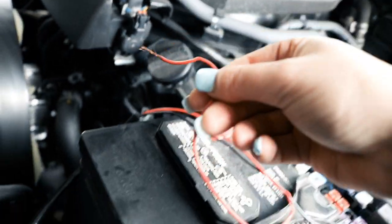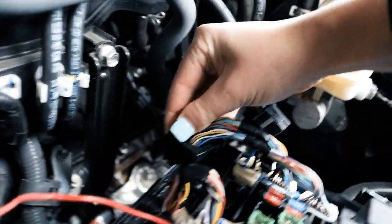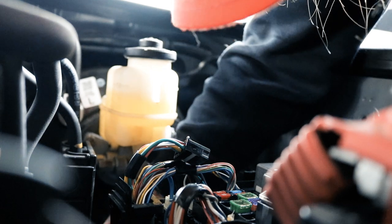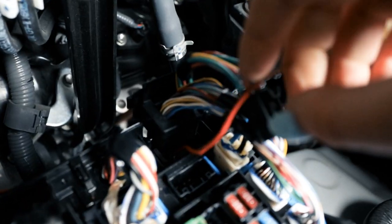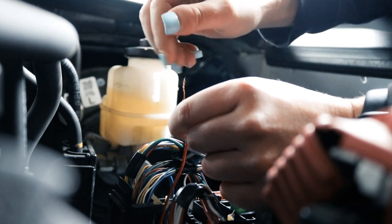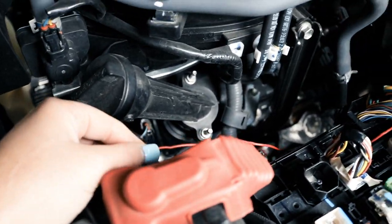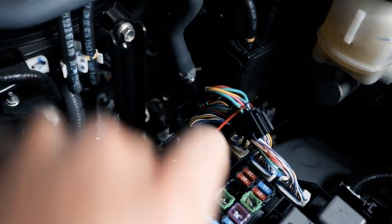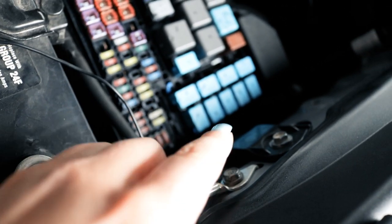Here is my positive wire that's going to the fuse box, and I'm basically going to feed it through the gap right there. Probably the hardest part is just feeding it through this little slot. Now that I have it through, we're going to put the fuse adapter on and connect it to the fuse box. Also I have the positive wire going into the actual fuse box, and then the negative — the ground — connected to the side of the truck. You have to remove this 10-millimeter bolt and put the ground connected right there.